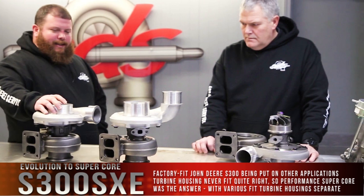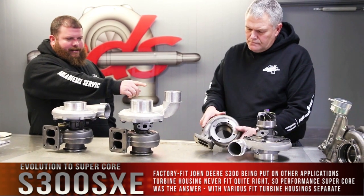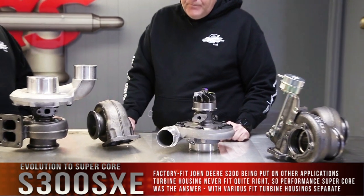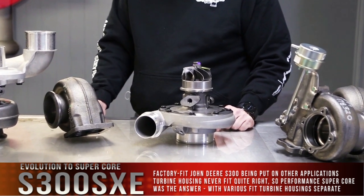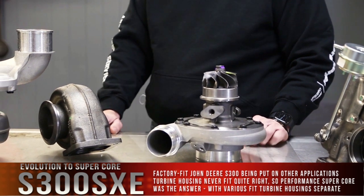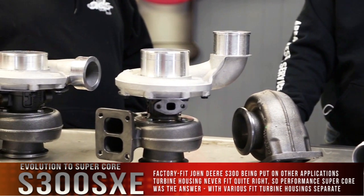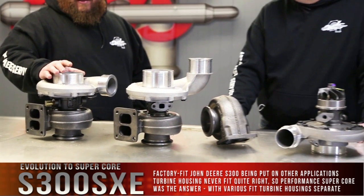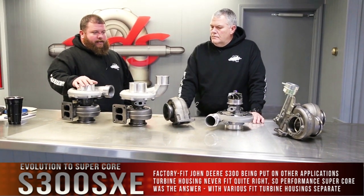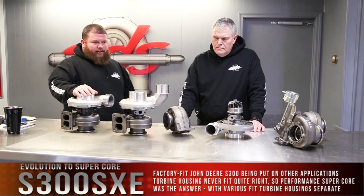The sales of those got to be so good, and they left just a little something to be desired — and that was really the factor that created the SXE, which is the new performance-oriented S300. Forever when we sold this, it came with the factory turbine housing, which never seemed to be right. We were always swapping the housing, trying to fine-tune for the application, which is the reason that these units just don't even include it. Quit throwing them away — just buy the housing that you need when you determine what you're doing.